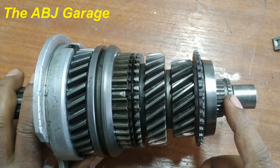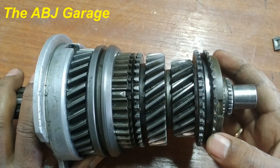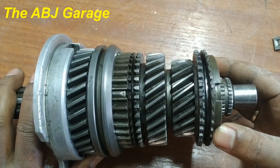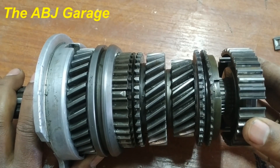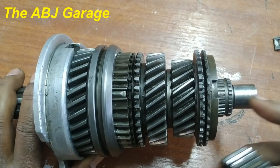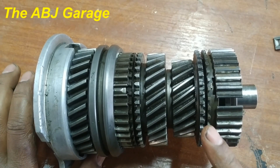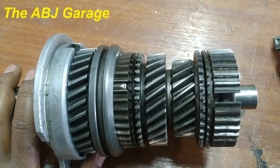In order to connect power flow from this gear to the output shaft, the speed of the shaft and the speed of the gear have to be synchronized. This is why we need the synchronizer ring — it will create friction that will cause the output shaft to have a similar speed to the speed gear. The hub is connected to the output shaft and always rotates with it.